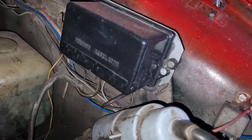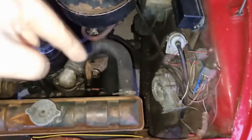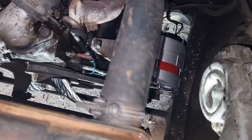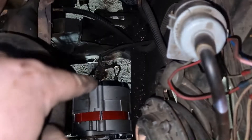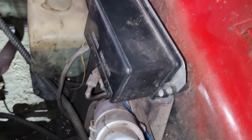I've rearranged and shuffled the wires up here a little bit so I can get the power to go around that regulator, because this thing of course has an inbuilt regulator. So I'm going to rip that thing off, rip the bracketry off the other engine, and get that thing sitting down there. And there we have it - the old generator is out and the modern alternator is mounted and hooked up with a belt. Well, not a new one but it's the right size - 9.5 by 825L. I've hooked the wires up and also wired them together underneath the regulator because they're not supposed to be hooked up to the regulator.